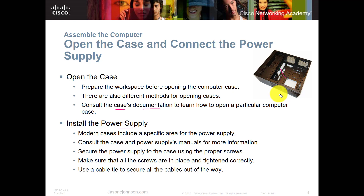A word of caution on working inside the case: be careful when moving your hands around inside the case because there are sharp metal objects and you can slice your fingers or hand open. I have done that in the past. When securing the power supply, put it in where it belongs — you'll have four screws on the back side of the case. Put those screws in, but don't tighten each one down individually; put all four in first and then tighten them about 90% of the way.